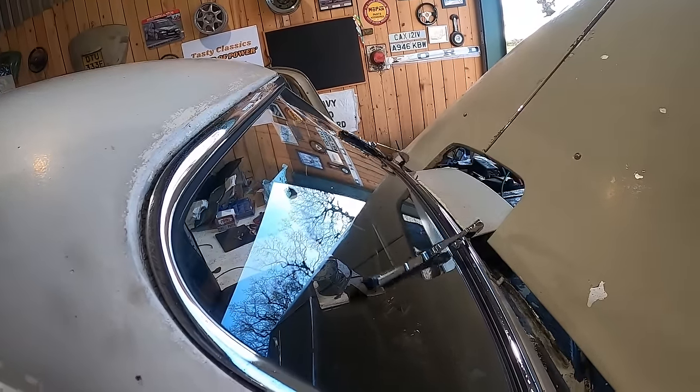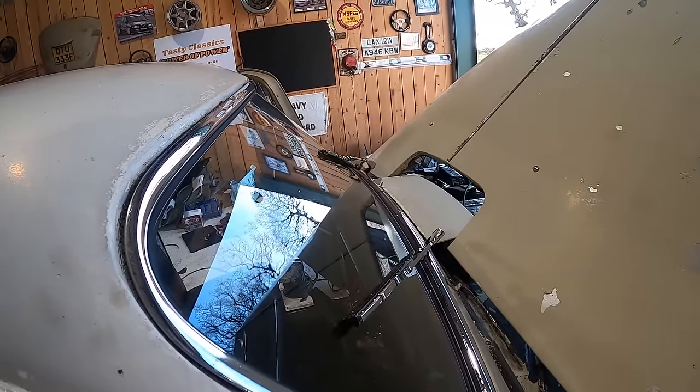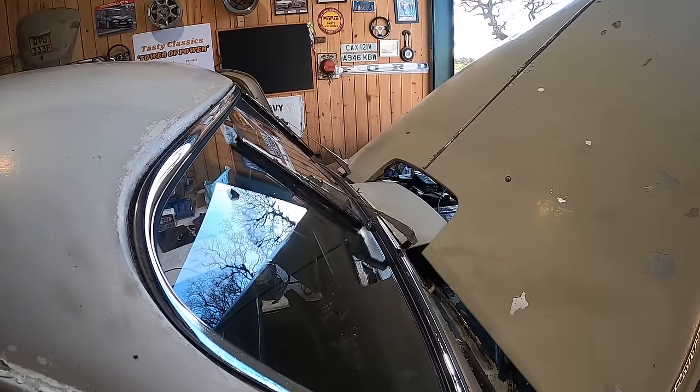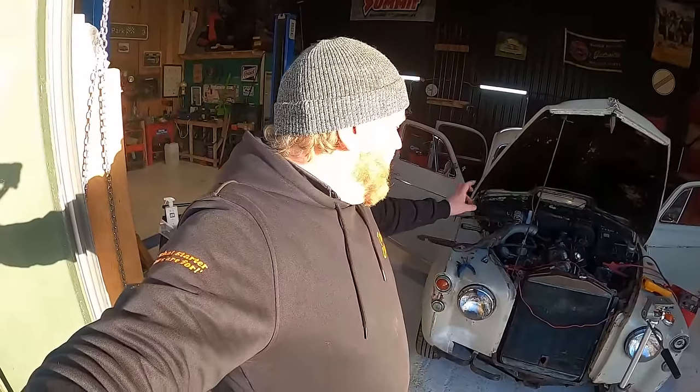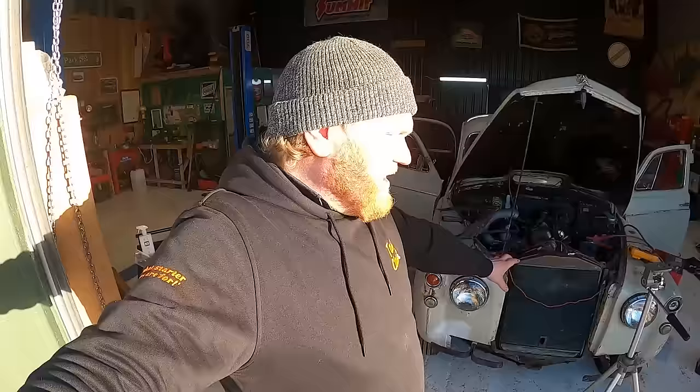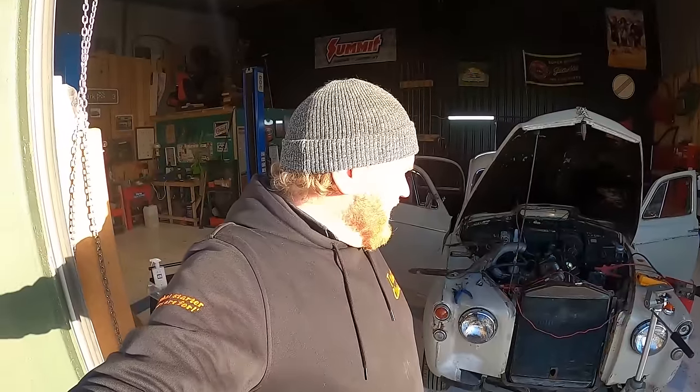I mean, desperate need for some rubbers, but how good. I mean, all we need now, I don't know if I mentioned the rear wheel cylinder had blown and I've got a seal kit on its way, but if I didn't, there you go, I've just mentioned it. That's coming. I need to do that, rebleed the brakes, get this fan installed, get everything worked out, button all the engine bay up perfectly, get it running very, very nicely, build the front end. I think we're going for a spin.